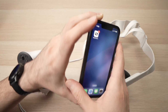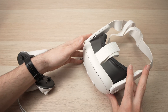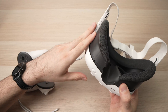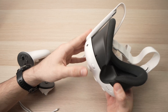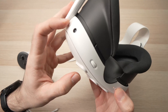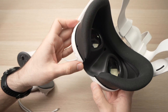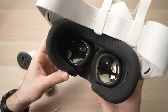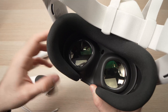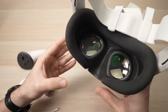Now let me show you how to do the same exact thing on the device itself, in case you don't want to use your smartphone. What you need to do is make sure your Quest is turned off completely. Then press the volume down button and the power button both at the same time for about three seconds. I suggest you put the headset on while doing this, because after a while you're going to see a menu appearing on the screen of the Quest 3. Once you see the screen, just release those buttons.